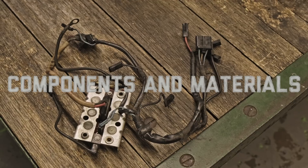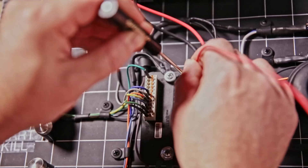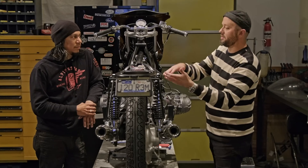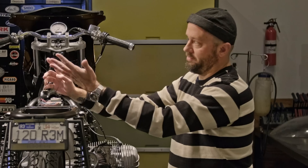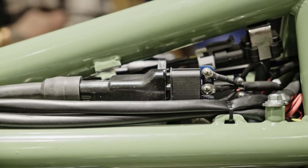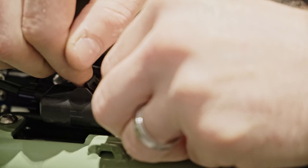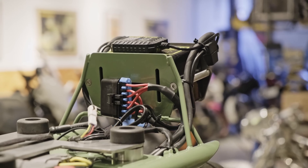You also get issues with old wiring that's started to wear where it attaches to a frame or components — you'll end up with a short from wiring rubbing against another part, which needs to be traced back. You'll blow a fuse. Is it the plug, the wire, or the component? You have to figure out which one. What Alec has learned is we now use much better wire with better insulation that's more durable, fuel resistant, sun resistant, and vibration resistant. We use better shrink wrap, better tape, better zip ties and attachment points, more secure screws, and better waterproof plugs — even the connectors are made to withstand heat and voltage. It's just a couple of dollars to upgrade to something completely waterproof that's going to last much longer.